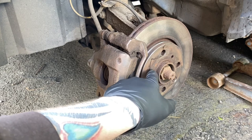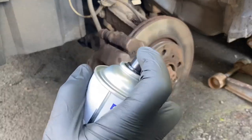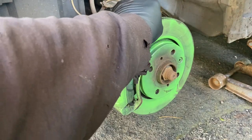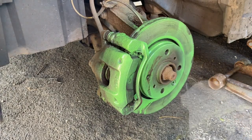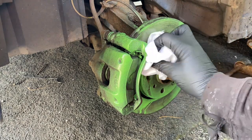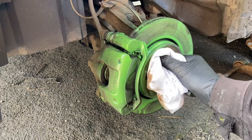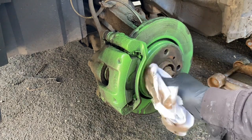Now the observant among you might have noticed that I didn't clean off this area here, because I don't actually want any paint to stick to that - that would obviously be downright dangerous and a stupid thing to do. So we've got to do this in a good way because it is brakes. We need to wipe the paint off the areas where we don't want paint to be, so carefully put some brake parts cleaner onto a rag and wipe the paint off this area, because if you have paint on this bit it can cause either the wheel to stick on, or the wheel not to stick on, as the painted surface compresses when you tighten the wheel up and can cause the bolts to come loose - which will probably ruin your day.